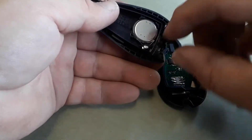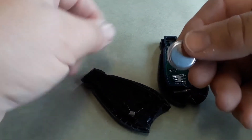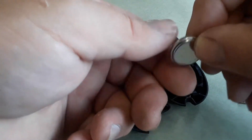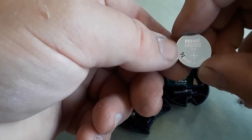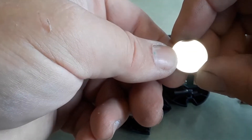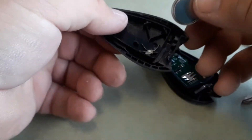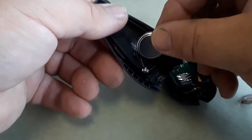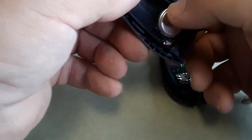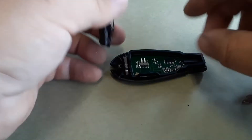Here's your battery. You want to use a little tool — there's like a little spring here. You want to kind of push in that direction and you pop that out. You can see it's a CR2032 — positive on the bottom. Get the new battery and slide it in from the top, so the negative will be facing out.